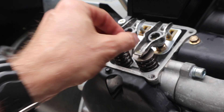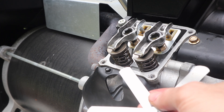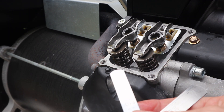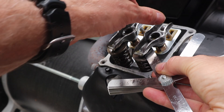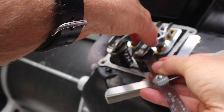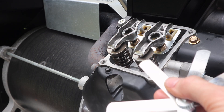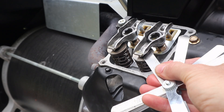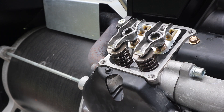At this point I'm going to check the clearances. I want to see between 0.002 and 0.004, so let's go right in the middle with 0.003. The 0.003 feeler goes in. We'll try 0.004 — there's some friction — I'm going to just play with the rocker arm a little bit and it just goes through. Let's see 0.005 — that's not going through. So that one's good. Let's check the other one.